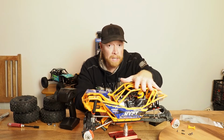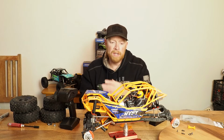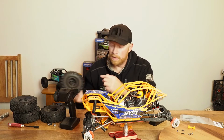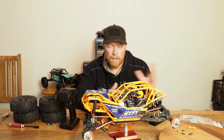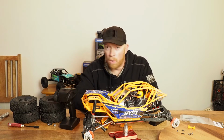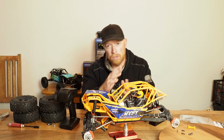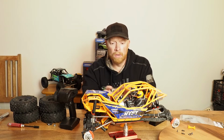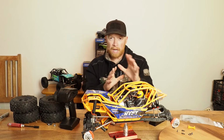The Axial Ryft is a very, very cool car, but on their website, for Axial, it says beginner to intermediate. I beg to differ. I actually think that this is more in the advanced because of the issues that I've already run into. With it spinning off tires that don't seem to fit on the hex properly, and for the amount of torque twist that the thing has, it requires a sway bar that is not available yet, and other issues like coming unbound all the time. And then the problem with people having to tear down the whole car to get the thing to rebind, and then finding out two or three times later that it came unbound again. So, as far as Axial goes with the Ryft, we need a little bit of work on this thing, and we're figuring these things out. But I'm not bashing on Axial.